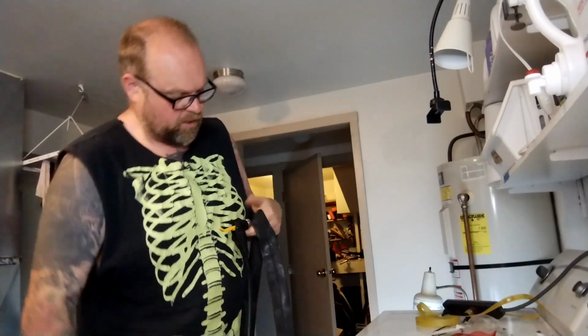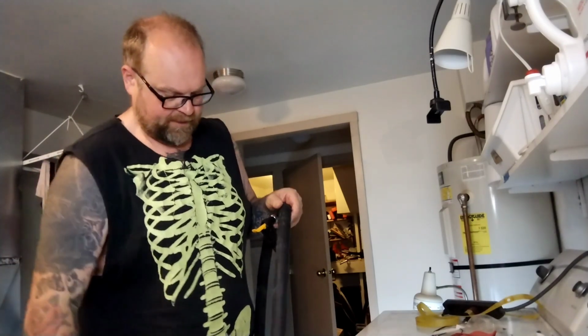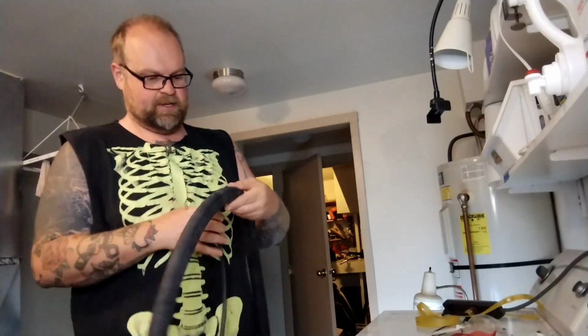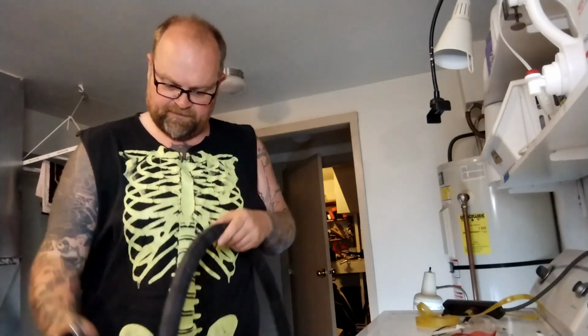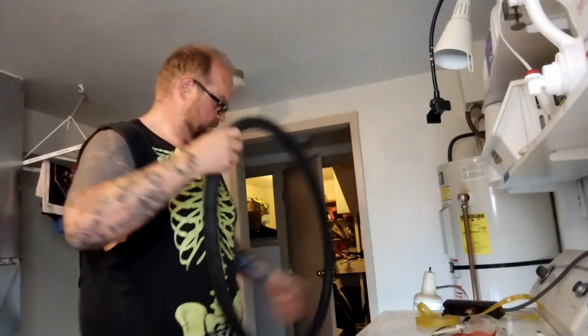The tubes, you always put a little bit of air in them. Not too much, just don't want them to be flat so they don't get pinched as easy. So just enough to make them a little bit round all the way around. It's funny, this tube is labeled much bigger than the other ones I have. It doesn't seem to be.